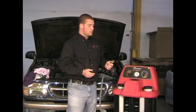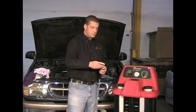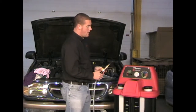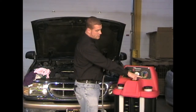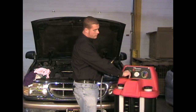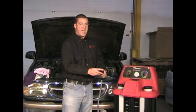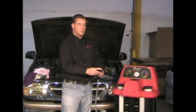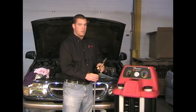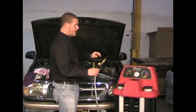After pinching the hose, we will take the service hose, insert the rubber cone adapter, and open the valve on the hose. At this point we will make sure that the right dial is on vacuum and we will turn the left dial to air on. The machine is now pulling a vacuum at the cone adapter. We will use the cone adapter to pull a vacuum on the vehicle by inserting it into the vehicle's radiator.